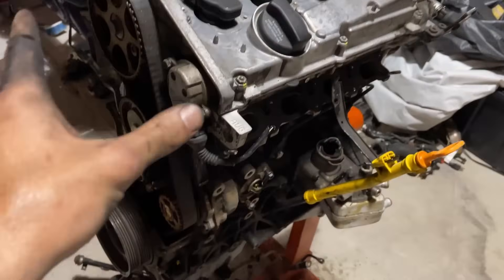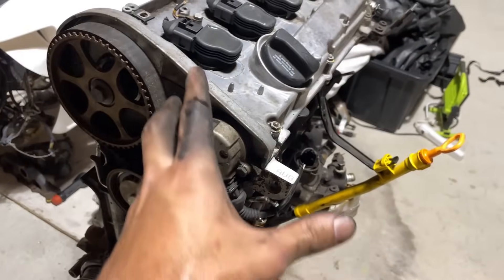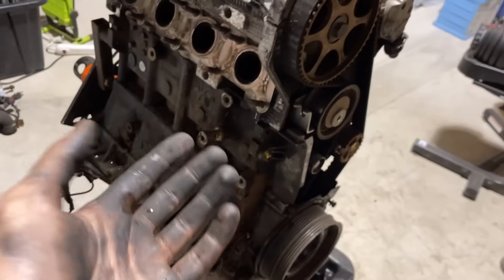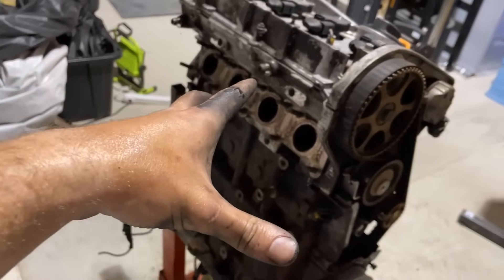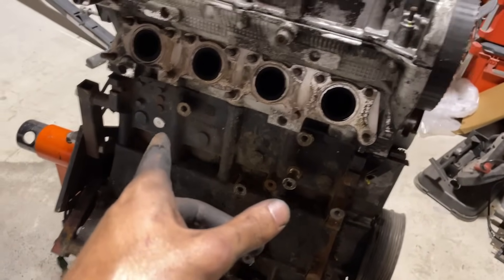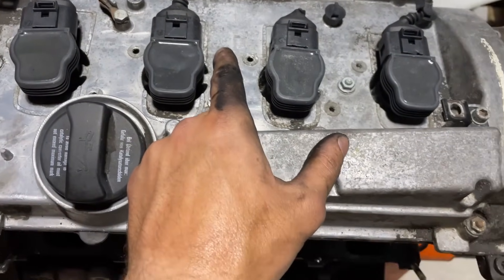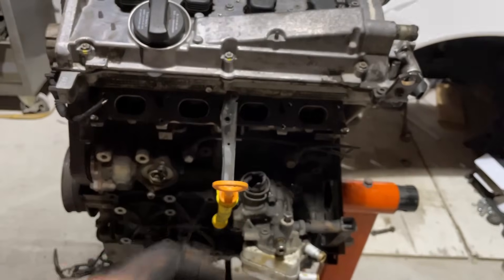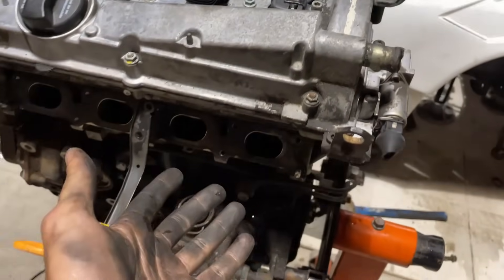There are even hoses coming out of here going to the back — I don't know if I can delete those either. Otherwise the engine looks pretty simple. The timing belt seems okay from the last owner, but obviously I'll do the timing with a new belt once it's apart. Maintenance wasn't horrible on this thing. I'm going to pop the head off now and see the true condition of this motor. I'll slow down from the time lapse and go step by step on the disassembly, then once the head's off we'll inspect and make sure this motor is good before going further and discuss the upgrades.